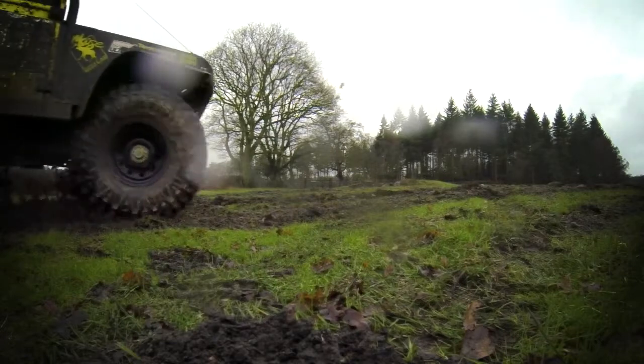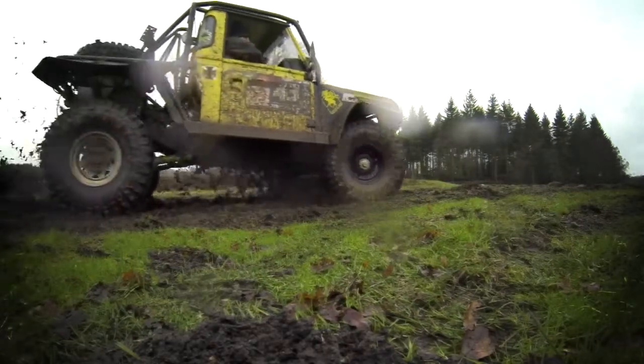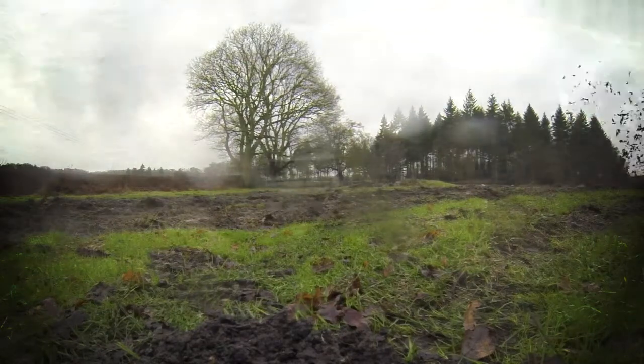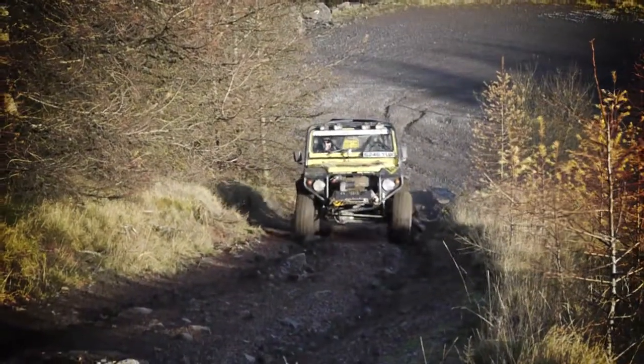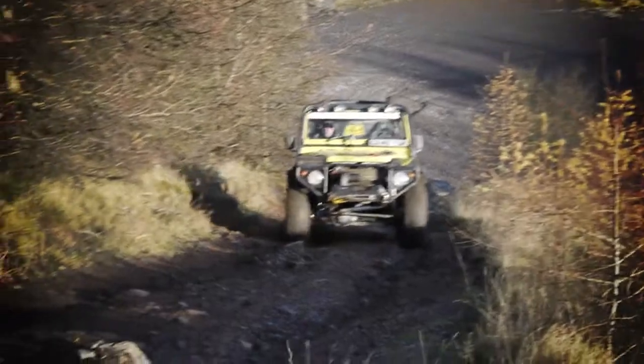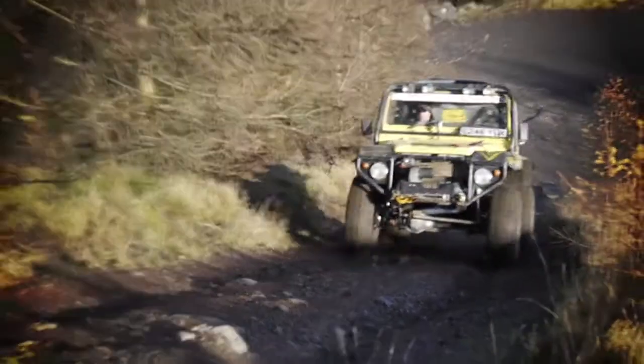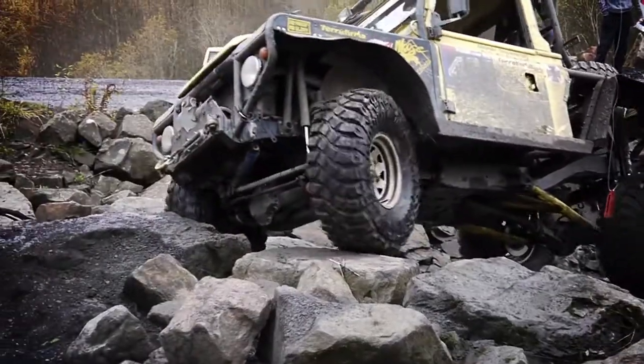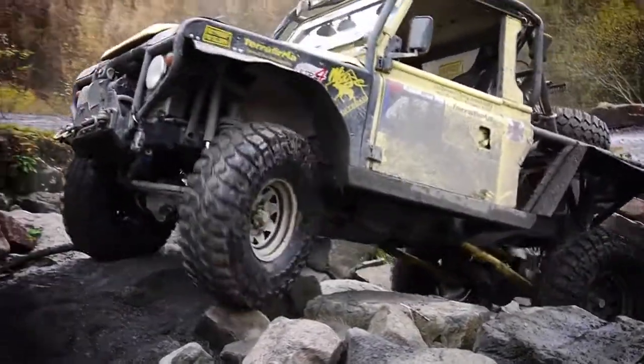In a suspension shock, the damping is controlled differently on the rebound and compression. A steering dampener is valved 50-50 so that the same amount of effort is needed to compress and extend it. The Terrafirma RTC damper has an added spring which will extend and compress along with the damper when you steer from lock to lock.